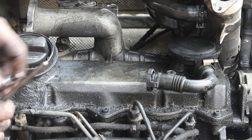All right, we're going to take our coat hanger on a drill bit, and simply work at taking it inside. We're going to take it inside each runner, and work to beat all the stuff out of there. Spend a good 5-10 minutes doing this because you want to get all of it out.